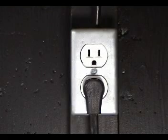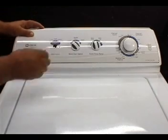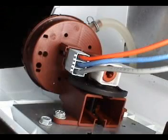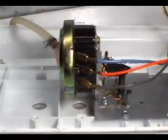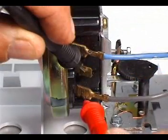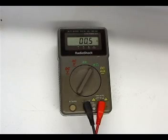Make sure the washer is disconnected from the wall outlet before proceeding. Remove the knob from the switch and open the controls panel. If the switch looks like this one, remove the wire harness and take a reading between the two terminals. If it looks like the other type, remove the orange wire and take a reading between those two terminals. With the washer empty, the reading should be close to zero ohms on both switch types. If the reading is infinity, the switch is bad and needs to be replaced.